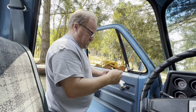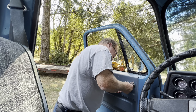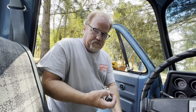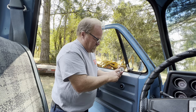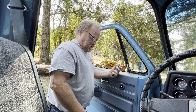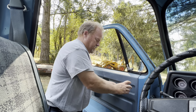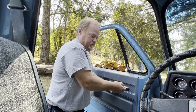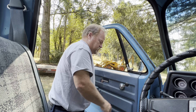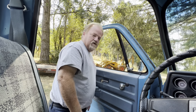I'll show you how they work. You shove this in behind there and it removes the clip. You slide it in like this, take it, slide it, and off that handle comes. What that does is it pushes this little clip halfway, then you just push it back in place. When you go to put it back on, you simply put it on here and smack it, and that clip will set back in place — and you're good to go. Really simple to do, doesn't take very long at all.